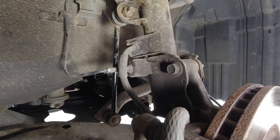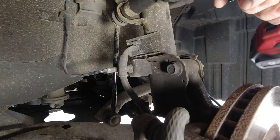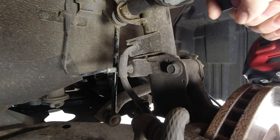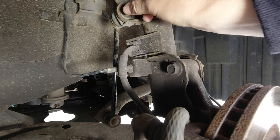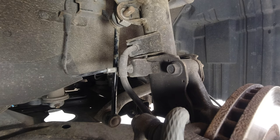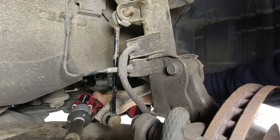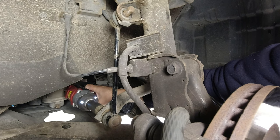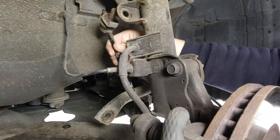The process will be very similar on most cars. If you're following along on an E51 Nissan Elgrand, I'm using a 19mm socket and an impact gun, though a spanner will do the job. On the Elgrand there are little tabs that turn with the bolt so it can't spin. On some cars you may have to put an open-ended spanner behind onto two flats just to stop the bolt from spinning. It's a little harder for access with the gun down here, but there we go — and then we can just pull that out.